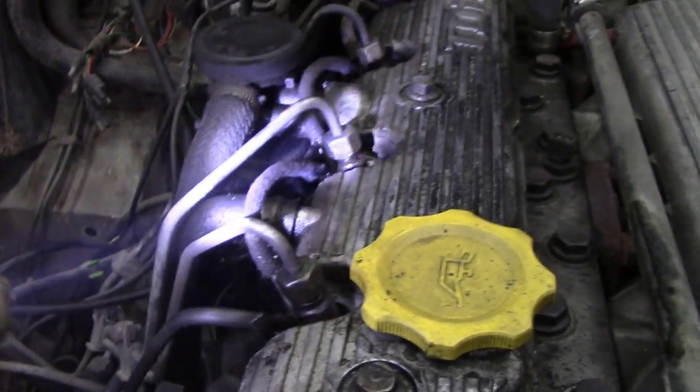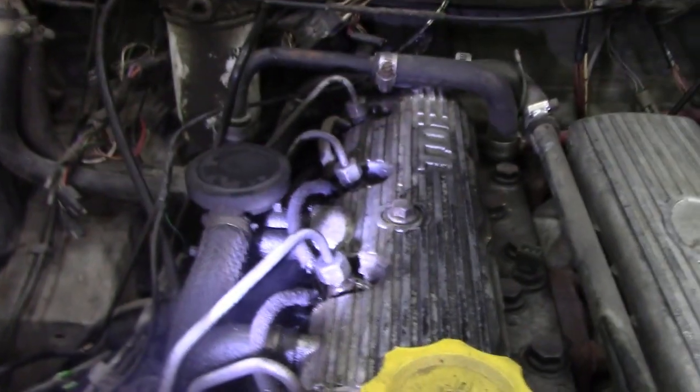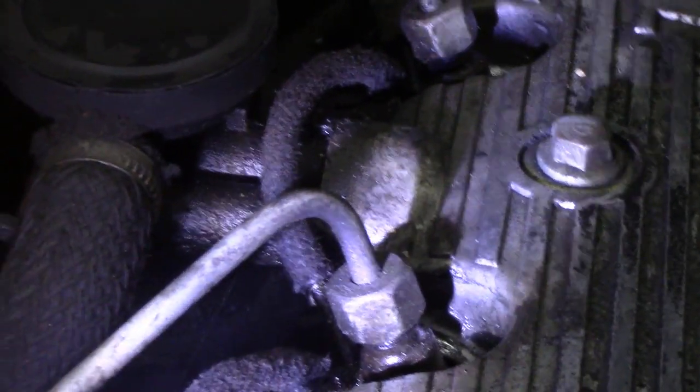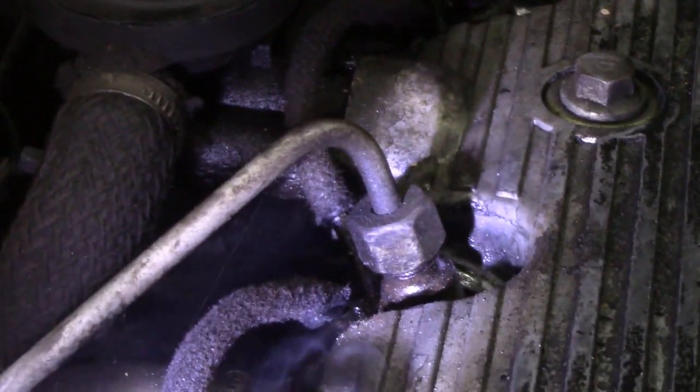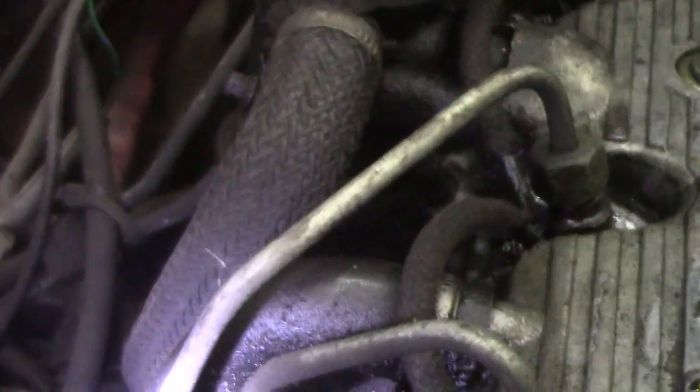You can see quite clearly where the oil is coming out. Look, can you see there? Let's zoom in - there's our old favourite, out of the O-ring that's on the breather. You can see it coming out there and it's bellowing out. So what I'm going to do is change that O-ring because it's obviously dropping down the side, but more importantly...